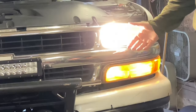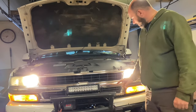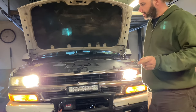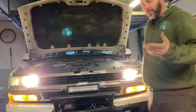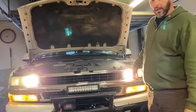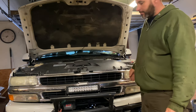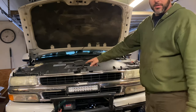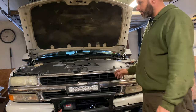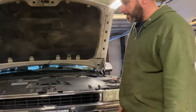The Hellas are pretty bright. I don't mind the halogen bulbs at all. I'm not sure if I'll swap my regular headlights to LED — let me know what you think. I really like these 100-watt Hella bulbs but I don't think I can get them anymore. To run the 100-watt high beams, I also installed a heavy-duty headlight harness to keep from burning the wires on the factory harness, which is prone to heating up and melting.